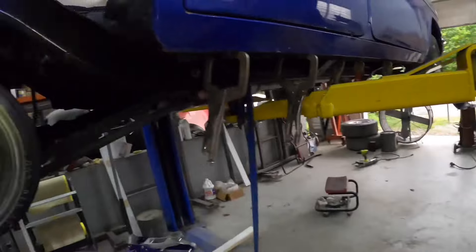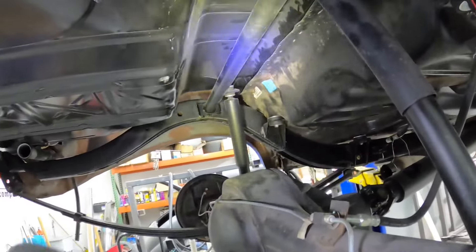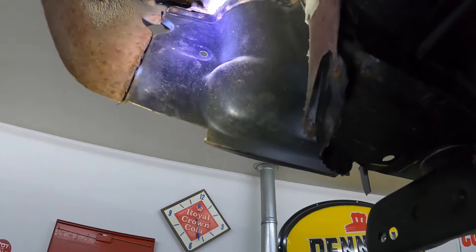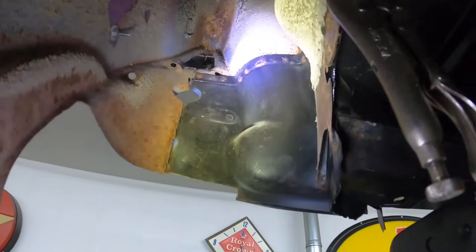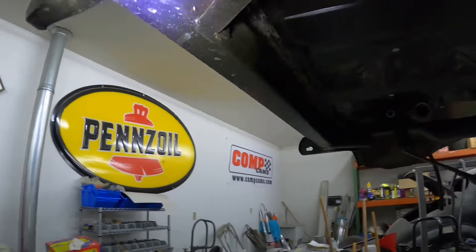So that's getting there now - a lot of work underneath the floor pan. This side is all tack welded back together - all the way across, all held on by a clamp. We're going to drill holes through this side every two to three inches, then weld the inner rocker to the outer rocker. And like I said, we're going to replace all that rusty stuff there. Next is getting that tail pan section on and getting the trunk aligned properly.